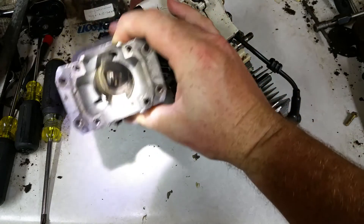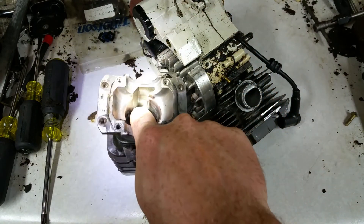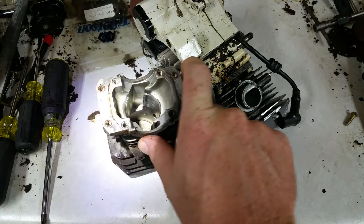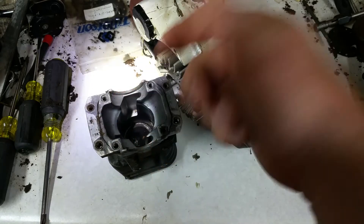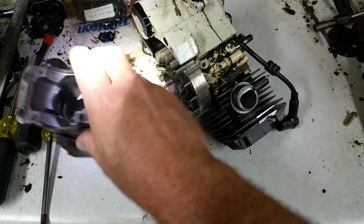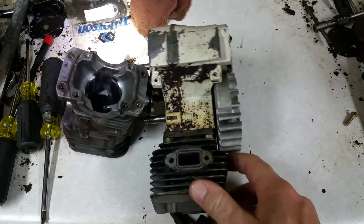The compressed charge is actually running up these runners on the side of the cylinder. As the piston comes down, those runners open up on top and actually let the charge into the cylinder. It's kind of difficult to see and kind of murky here.